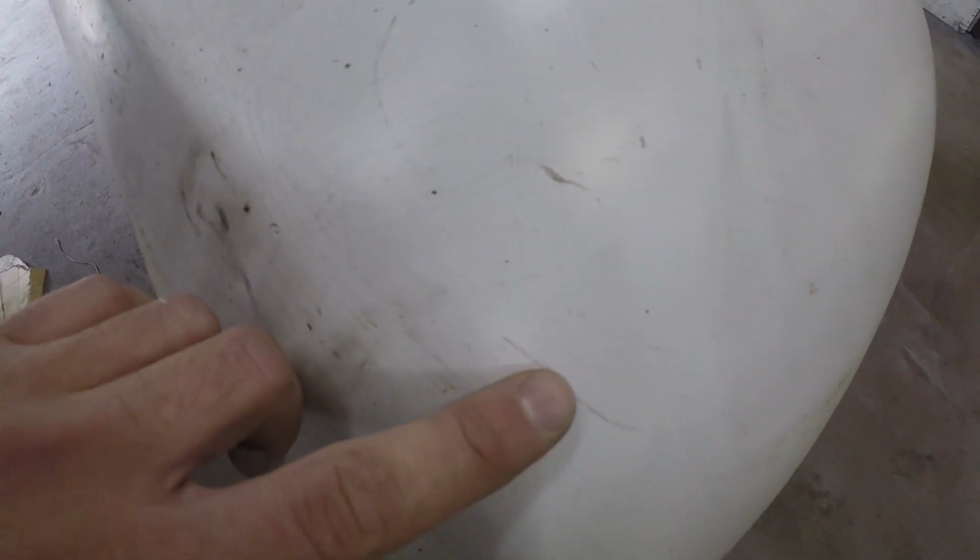But for today, I just got to prep these bumpers mainly, since it's off an old car, and what happens is every time you hit something, or the bumper bends a little bit, the paint tends to crack, and then in order to fix that, what you have to do is sand the bumper back down to bare plastic, and then repaint it starting from scratch. So the rear bumper has those cracks right here, as you can see them.